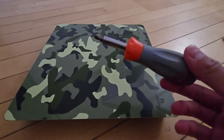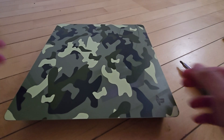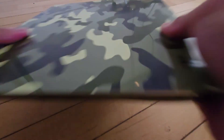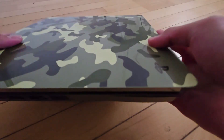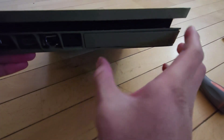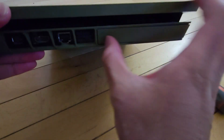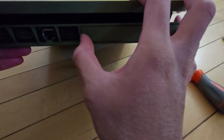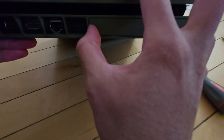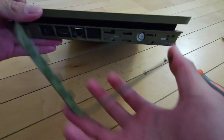For our next method, you will need a screwdriver — I already have one right here. One thing you can do is just shake your PS4 and you can hear that rattling sound, which means the screw is not tight, so hopefully this will fix that. In a PS4 Slim — and if you have the PS4 normal edition or the PS4 Pro, the hard disk locations may vary — at the back you will have this detachable bracket. Just put your finger right there and pull it up. See, it's that simple. So this is already off.